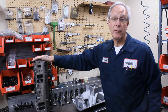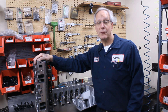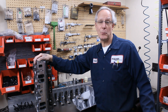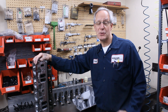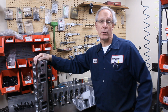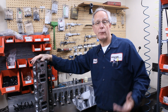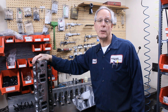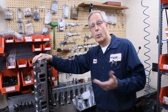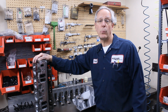You'll know if you're racing against the 185 Vortec Bowtie heads — even the 220s — because typically if somebody's got that and a matching camshaft from us and a good intake, you're generally going to be running for second place. They're just an awesome set of cylinder heads and they're going to serve you really well in most circle track applications. We can also modify your cylinder heads if you have a set and want some work done, from performance prep to the undercover work to CNC porting. We can also fit an intake and set up with the camshaft.